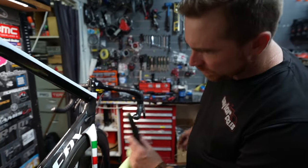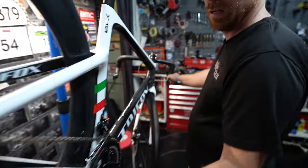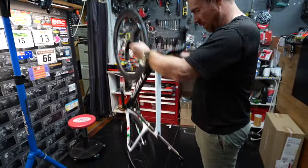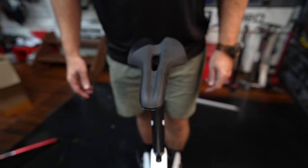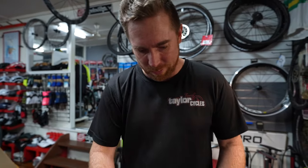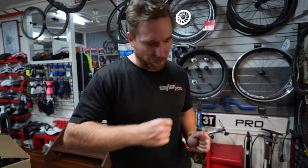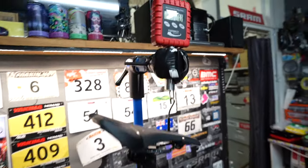A couple of final issues — this has decided to snap. The gears were tuned and now it's broken and gone out of tune. That sound? A bit of plastic gone and stuck somewhere. We've done these bolts up and over-torqued them trying to stop this from happening. The carbon cradle is basically a different shape on either side — look at that movement, and that's fully torqued up. When you're putting max watts through with your whole body it's going to move. It's way heavy for an aero bike on a rim brake too — pretty heavy.